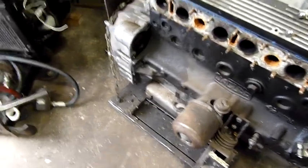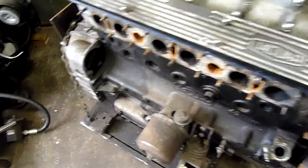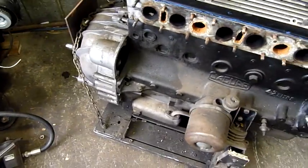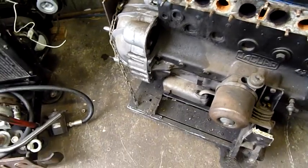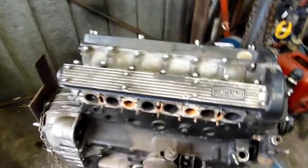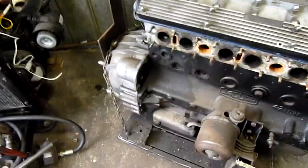I'm just in the process of unbolting it, lifting it up with the crane, and I'm going to wheel this trolley out from under it and just drain the oil into a tub. I was going to try and vac it out, but it's really viscous heavyweight oil, so it'd take a while and be messy. I'd rather just lift it up with the hoist.